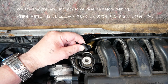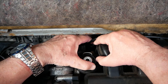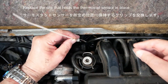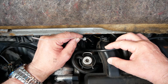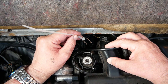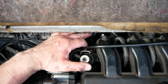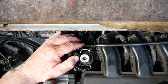So I've got no air locks to that point, so I can put the new thermostat sensor in — pop it in. Perfect. Now the clip. That's going to fit in front of that clip and back. I'll put a tie wrap on because invariably I'm going to drop it a few times. It should take a while to get this little clip on. Just get that clip on there, make sure it's all clicked into position — nice and sweet. Connected.